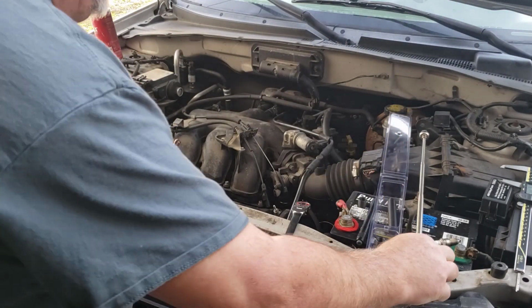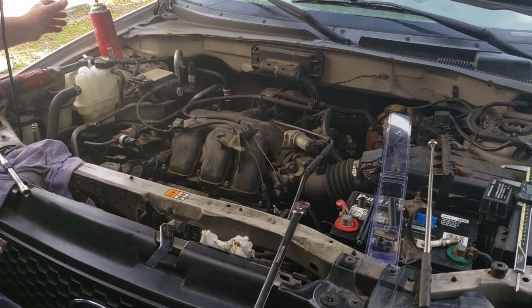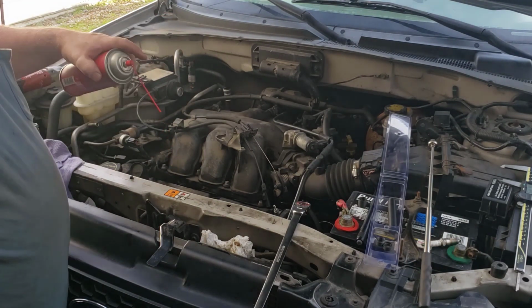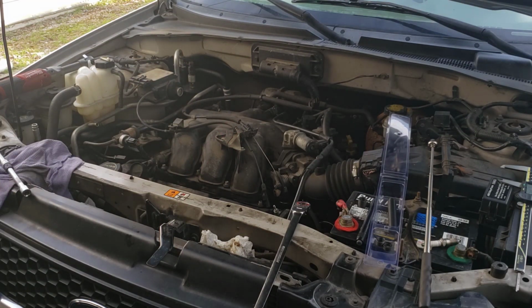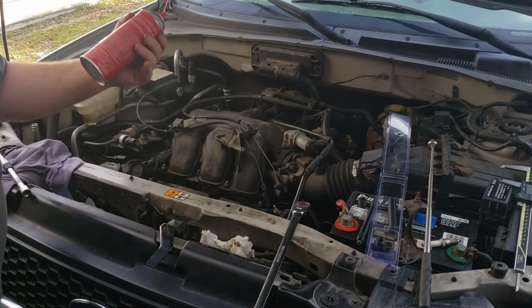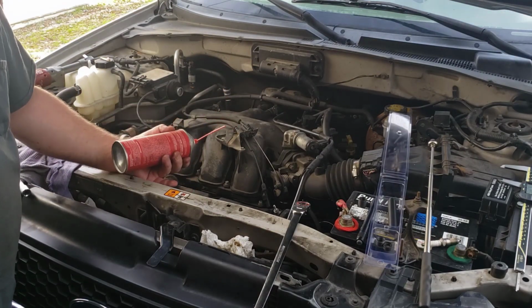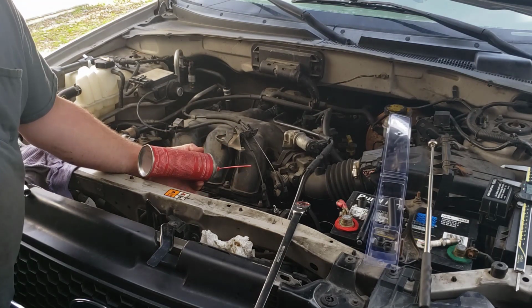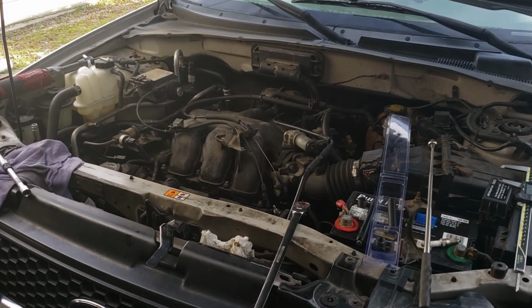So at this point in time, and this is something that I do, I'm going to get an air wand and stick it all the way down there close to the piston. Then I'm going to blow air down into the cylinder, and hopefully by doing that, the chips up here on the threads will be carried out, because the air is naturally going to blow back out.